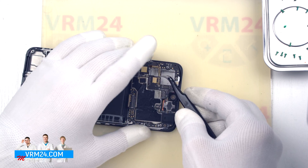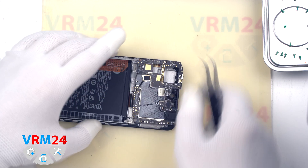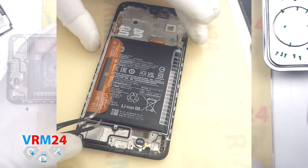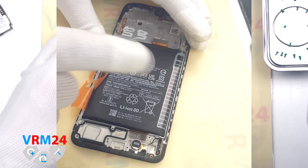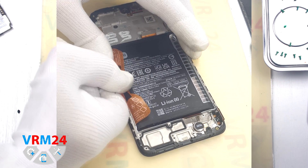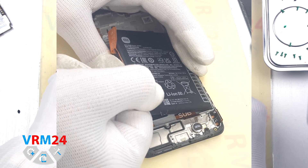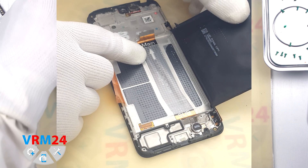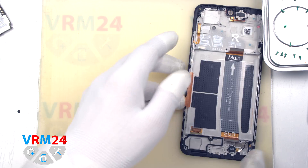On the back side, the motherboard may be held on by thermal paste. Finally, we move on to detaching the battery. We need to unwrap the brown tabs A and B and read which one to pull. As it becomes clear from the description, we have to pull the white tab upwards. With one hand we hold the display frame and with the other hand we gently pull the tab with the letter A upwards, detaching the battery. The battery is also held on by a transparent protective coating, which protects the interboard cable.